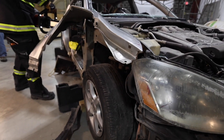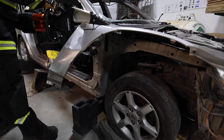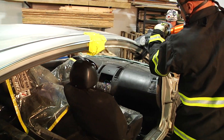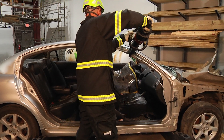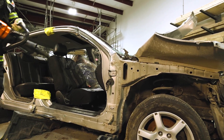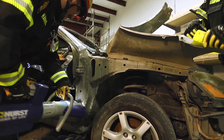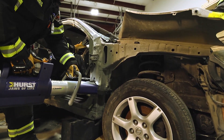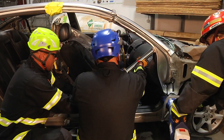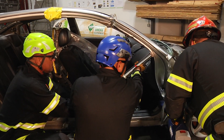Kirby is skinning out the fender skin — you'll notice his bottom bolts have already displaced. All we're doing is exposing that lower portion of the A-pillar so that we can identify all our strategic benchmarks to make the proper cuts. Kirby's folded that out of the way well. We're making a high A-post cut now. As soon as the upper A-post cut is completed, the ram is going to come in — this is a long reach from what's remaining of the B-pillar weld seam. We're going to use two rescuers to position that properly. Make sure you have two points in, two points out, and go for the neck of the upper A. Watch your tool placements on this angle push and make sure that you are perpendicular to your materials. The move is driven by the ram and chased by the spreader once the cut is complete, making one complete cut through the lower A-pillar.